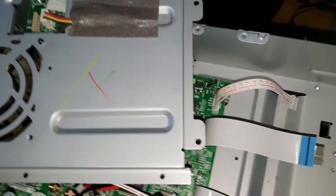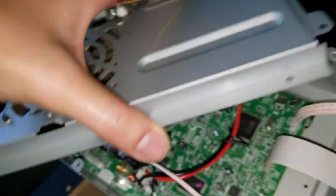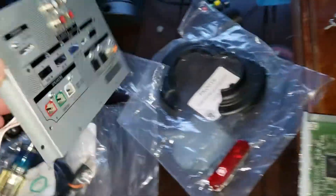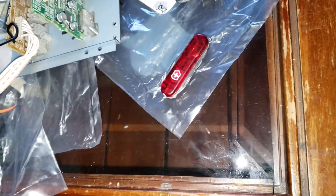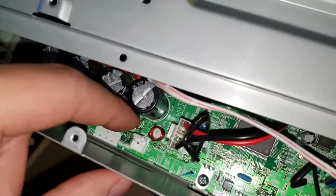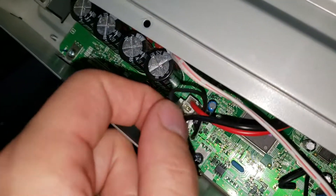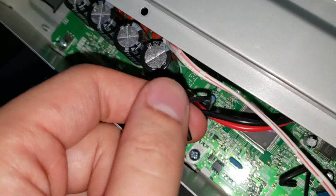Don't pull too far since there are a lot of cables connecting them. You'll have the fan cover, which is connected by its own cable, and the output cover, which has a whole bunch of connections you'll probably want to undo to pull it out. You'll undo one ribbon cable from the top board that handles audio, and a lot more cables from the HDMI board. You've got two ribbon cables to disconnect, some audio cables with a little clip to pull up, and this connector which you just pull directly off. The cables are held together with cable management wires that you just bend out of the way.